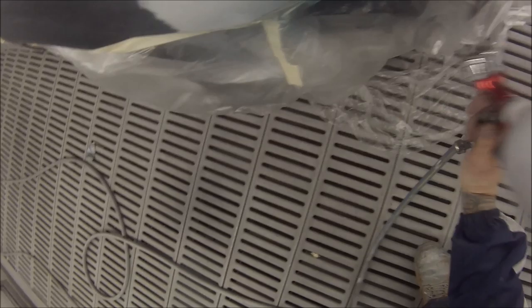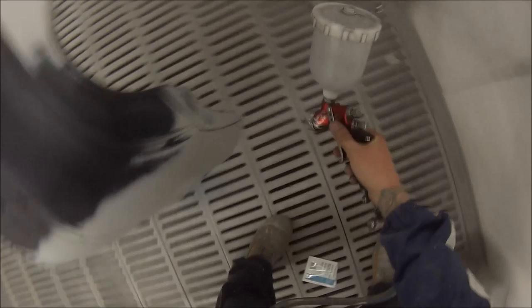Once we've got that done, wipe down the air line — little things like that make big differences when they all add up. Using the high pressure air and wiping it down three or four times is never going to hurt and sometimes makes all the difference. I used to just do it once and decided to start doing it twice and found my jobs coming out a lot cleaner. You've spent so much time on your prep work, so slow down on that final stage — you'll get less dust in the job, it'll look better and you'll have less polishing, which nobody really likes.